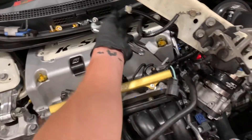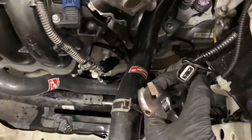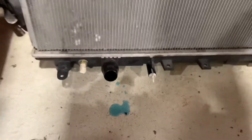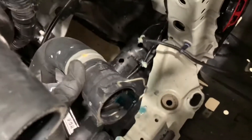The horn is here. I went ahead and took that off for now, and then you'll have to disconnect the harness to the radiator fans and then disconnect the OEM radiator hoses.